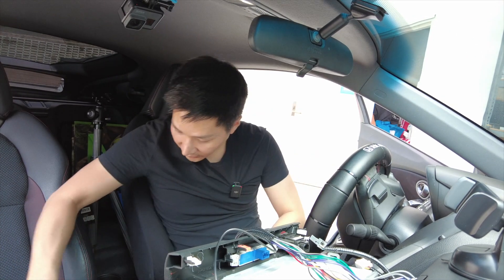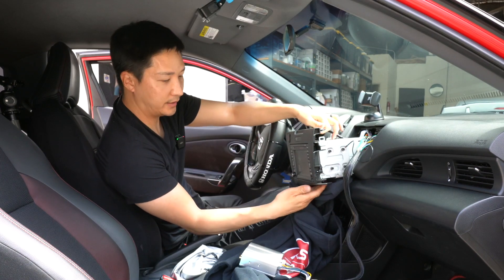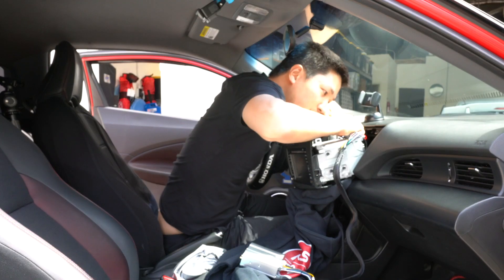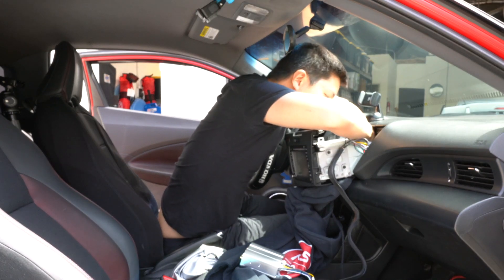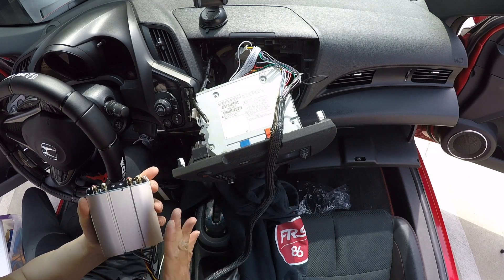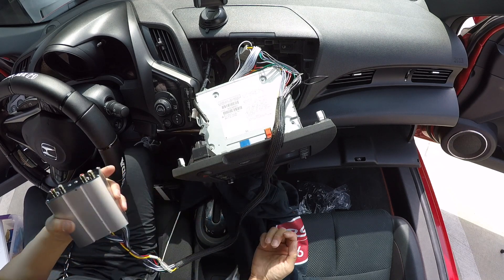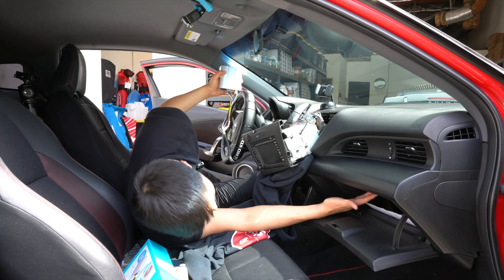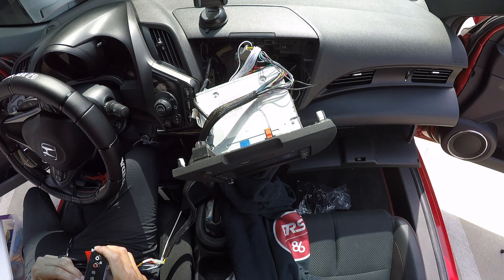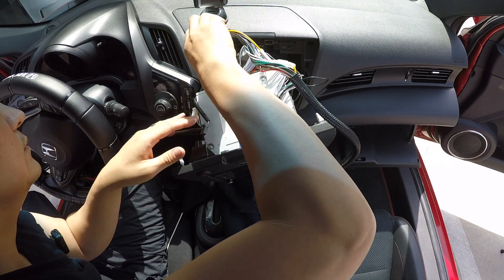Let's go ahead and make some adjustments to the gain — even it out first and then do a quick test. It seems like it's working. Now I'm going to look for a place to mount this amplifier. Ideally we'd place it behind the radio, and it does look like we have room back there. However, there's just too much space — even with foam tape it's going to move around, and since this amp has some weight to it you don't want it banging around inside. Instead, I found a flat surface behind the radio going all the way to the right, to the left of the glove box, and we'll double-side tape it there. Remove the adhesive and carefully maneuver it through.